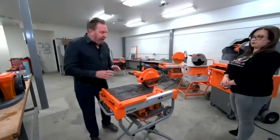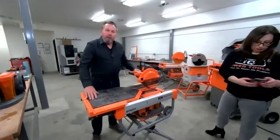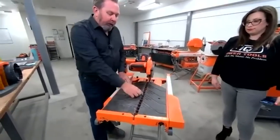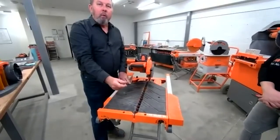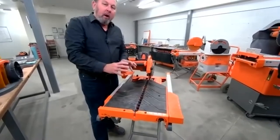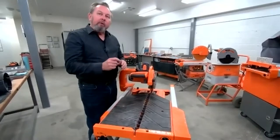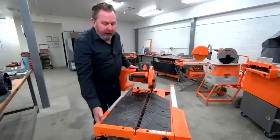Let's talk about the machine as a whole. The louvers are a very important part of the machine. You can look straight down the louvers. What's going to happen is over time, this little slot that the blade is cutting into is going to get wider and wider. That's because the blade as you cut kind of deforms, and if you're pushing hard, the blade deforms a little more and you have a wider slot. That's particularly true with the 362 because it has a wider blade. So putting a fresh set of louvers in the table is very important.